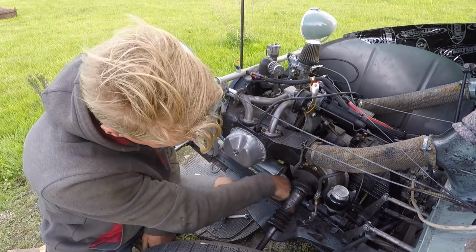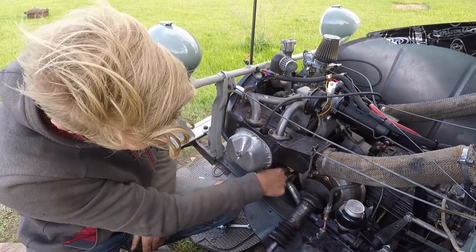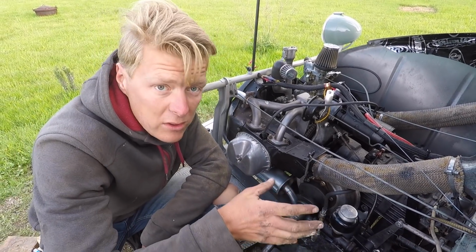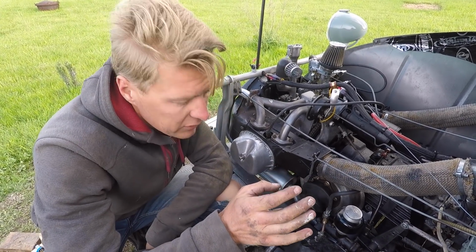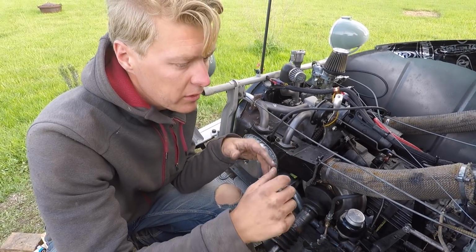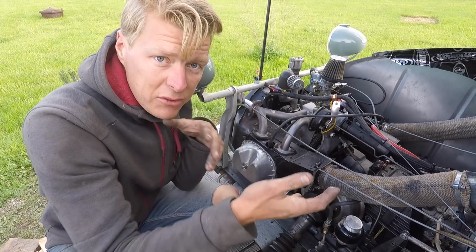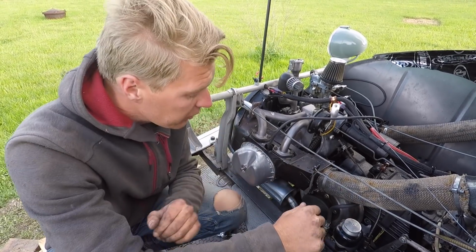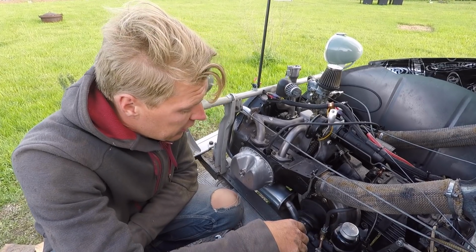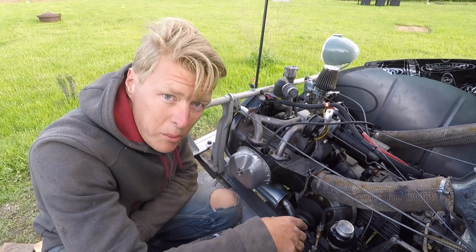So like I said, this bit was bent out of shape, and so was the bracket. It happens when you're welding stuff. You have to do it in a jig, and you have to cool it down with an air hose as you do it, as you work, because otherwise everything warps and twists as it heats up. And that's simply, I think, what had happened in the factory, and it was just dramatically off.